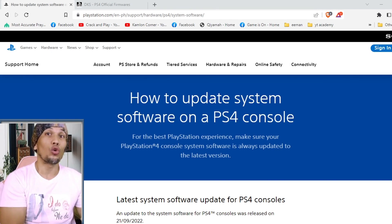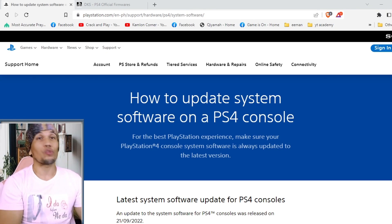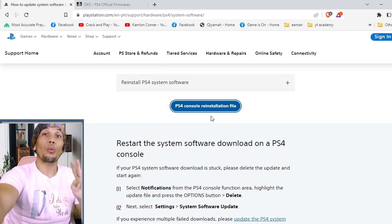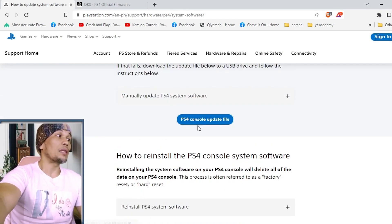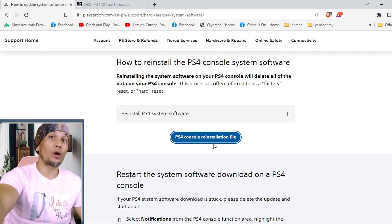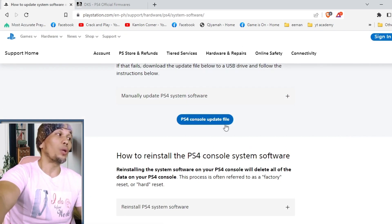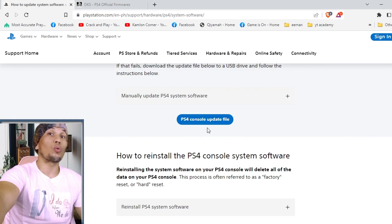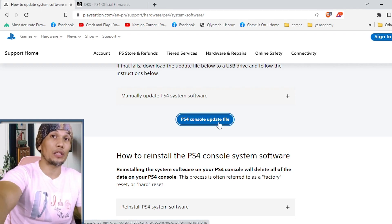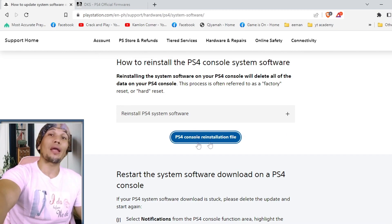Why do we need to be careful? If you are on 9.0, you don't want to install 9.60 or 10.0, because once you start the update you won't be able to revert your firmware unless you made a backup. I will leave a link in the description for where to find firmware updates. You'll see two options: the PS4 console update file and the PS4 console reinstallation file. When changing the hard drive, we need the reinstallation file — using the regular update file will cause the PS4 to reject it. The reinstallation file is only needed when the firmware can no longer be loaded or you are changing the hard drive.